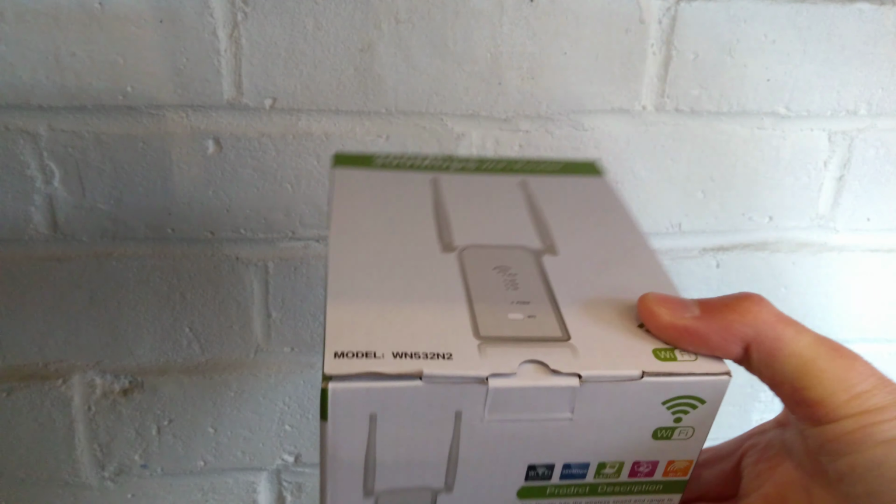So here goes, I've now moved on to my computer, and I have no network cables plugged in at the moment. I shall plug the Ethernet adapter of my computer into the LAN port of the router. The LAN light has lit up green, and my computer has got an IP address in the default range, which is indeed written on the side of the box as well. So now let's go and have a look at the web interface of this router.